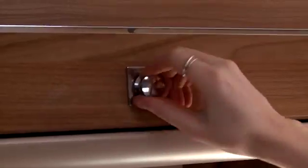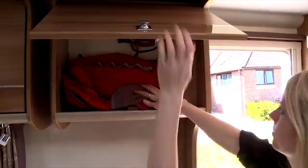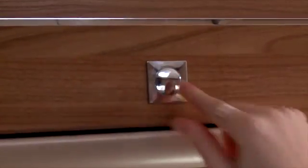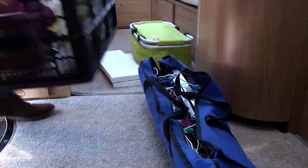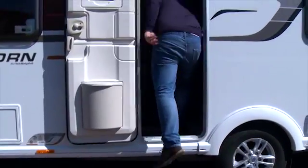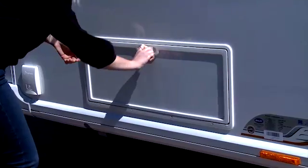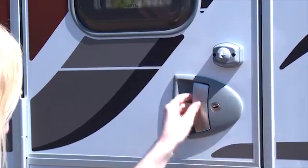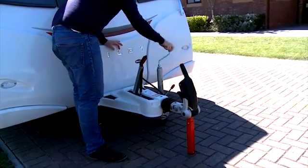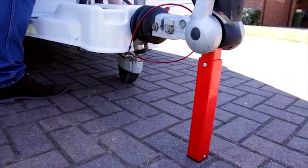Ensure that all possessions are stowed away securely to avoid any breakages. Findings from the Bailey-sponsored research from the University of Bath has shown that when it comes to stability, weight distribution really matters. Therefore, make sure all heavy items are positioned at floor level over the caravan axle. Finally, go back outside and check all external doors are securely locked. Periodically, it's worth checking your caravan's nose weight is within the manufacturer's limit to ensure trouble-free towing.